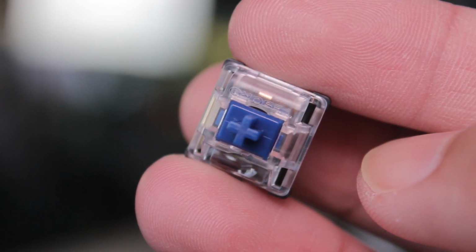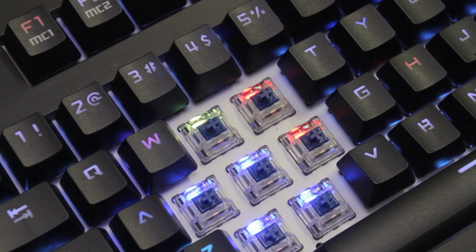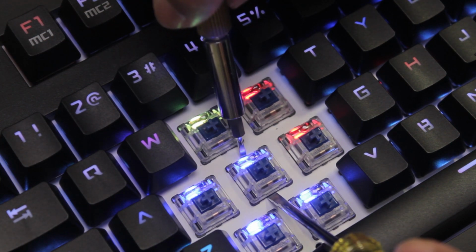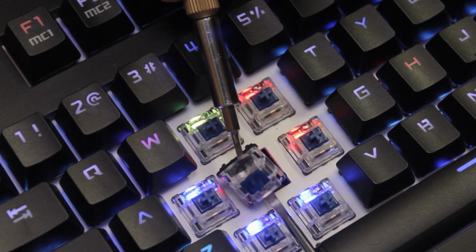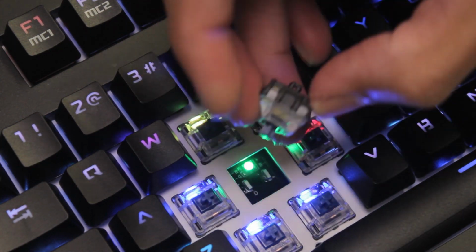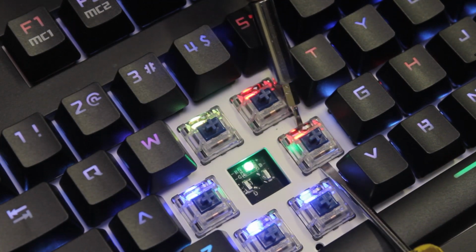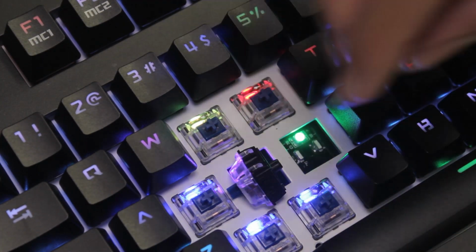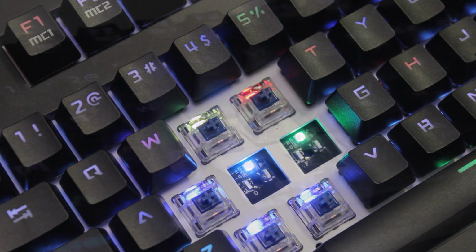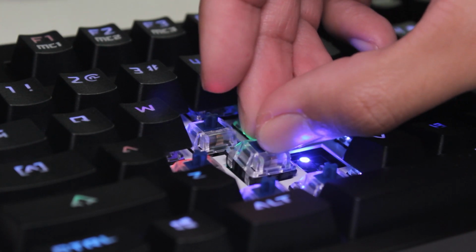Since there are no pins, the switch doesn't need to be soldered to the PCB, because all it's doing is blocking the infrared signal, so it's super easy to just unclip and remove the key switches, which is a feature of the keyboard. However, they do not provide a key switch puller, which is a bit odd. However, it's really easy with just a flathead screwdriver or tweezers to take them out. Consequently, you can't use any old key switch since the bottom housing prong is completely solid and therefore would stay permanently actuated.